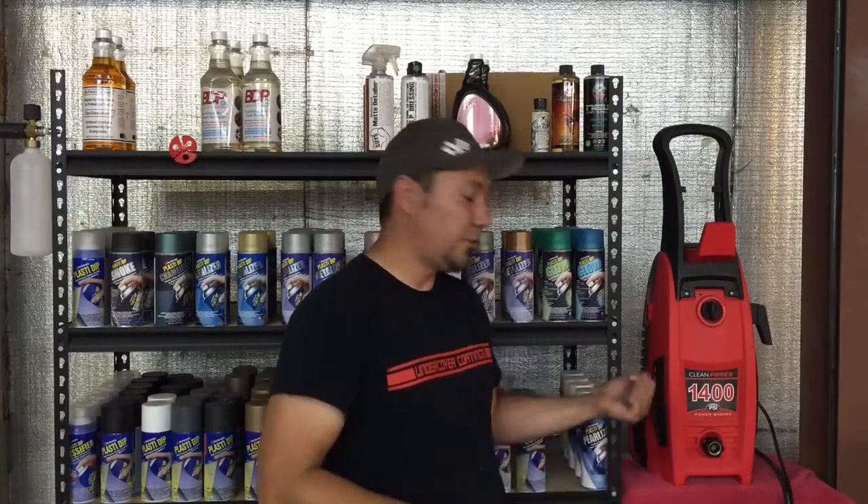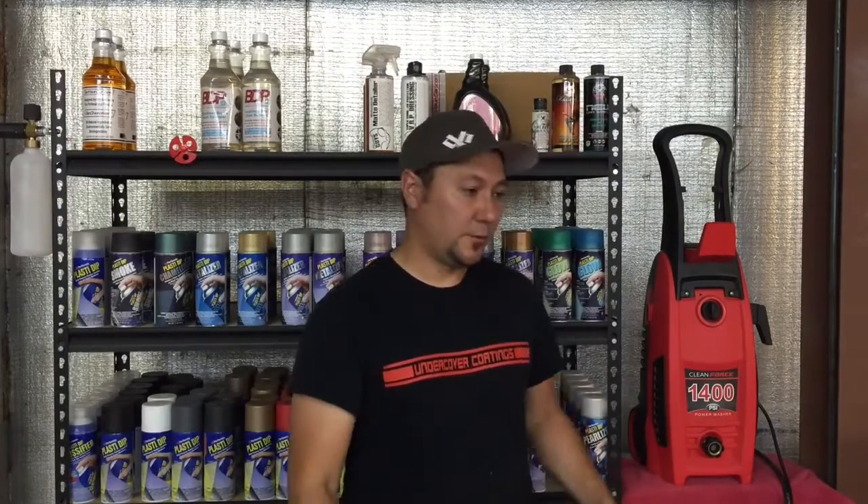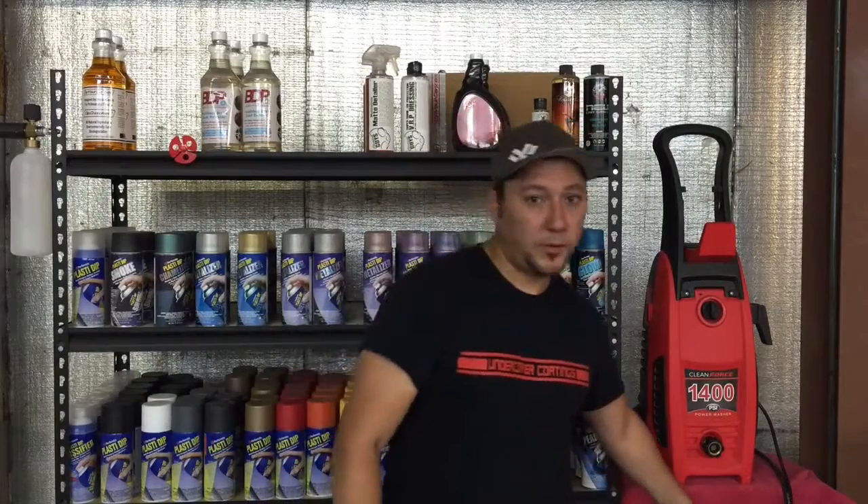The next thing is the pressure washer. I use a 1400 PSI one — this one doesn't even have removable tips and it works just fine, so if you have a low-cost one you're probably good to go. You can use 1800 or 2000 PSI, but I wouldn't go above 2000 PSI because it's pretty harsh when the vehicle is bare paint, and you want to avoid that at all costs — just the dip removed, not the regular paint. Third thing to consider is residue: you're going to have liquefied dip flying around as you saw in the time lapse when I cleaned off the hood. It's going to be a little messy, so that's why I had tape and drape around the edges of the roof.